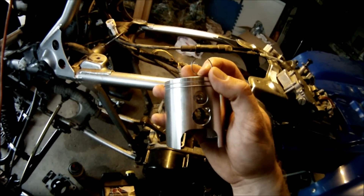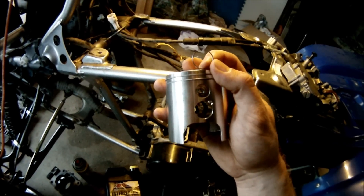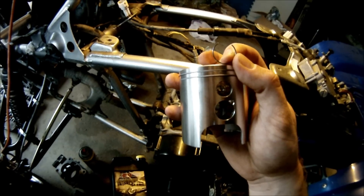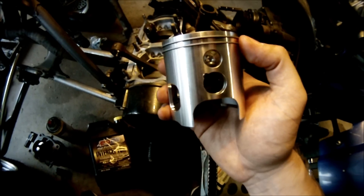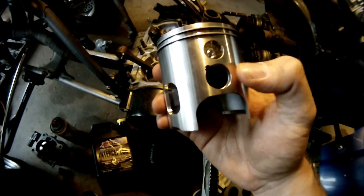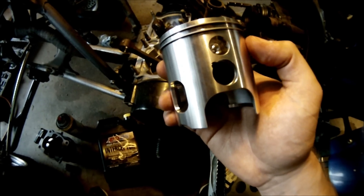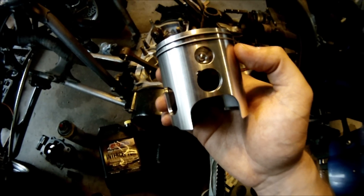Next I'm going to install one of these clips on the piston. I just have to slide the wrist pin through the wrist pin bearing. I'm going to install the clip on what would be the inside of the piston. The easiest way to do it is to just bend it a little — not so that it's permanently bent, but just enough to get it in there. Then stick the slide pin in from the other side to level it out, and it should click right into place.